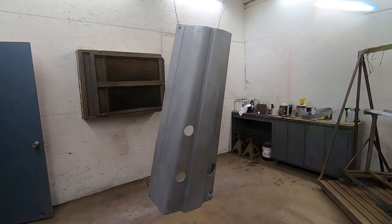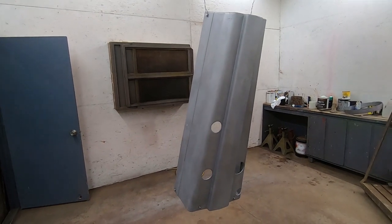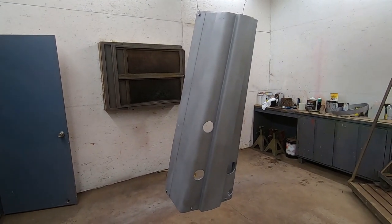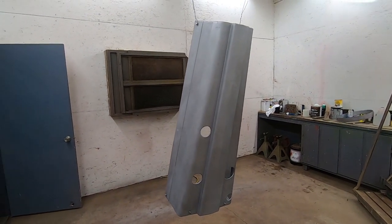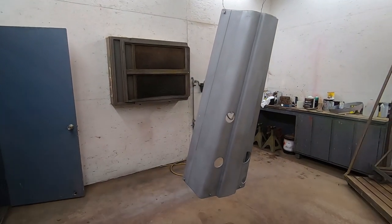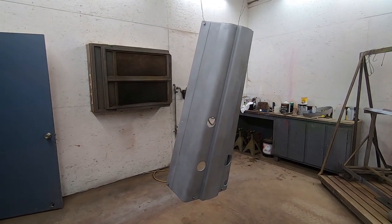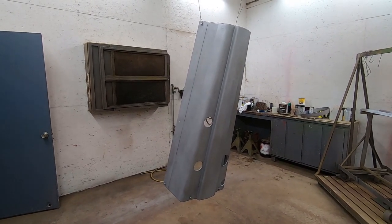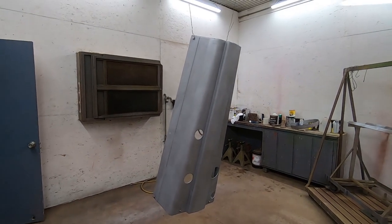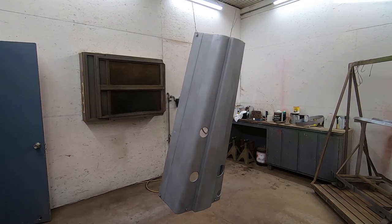The other thing I like with this epoxy primer is I normally don't paint underneath the hoods. They weren't painted underneath from the factory, so I'll prime them. They're black underneath, or at least primed so they don't get rusty. But this one she takes off to use it so she don't scratch it up. So this one I'll probably paint green underneath, but the last tractor is just primed. Their primer's got UV resistors in it. They use them for frames and stuff, and it's rated to not be top coated.